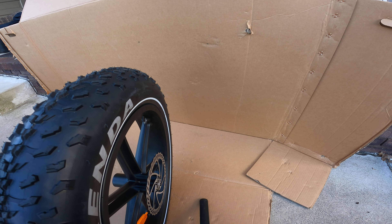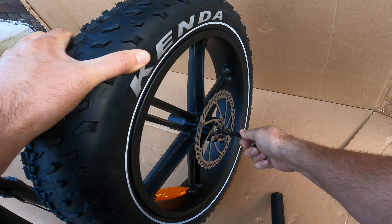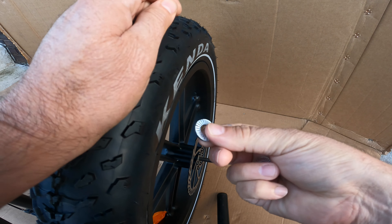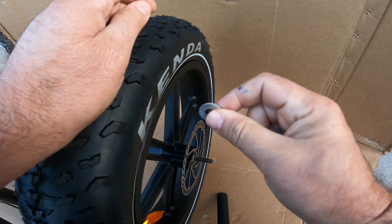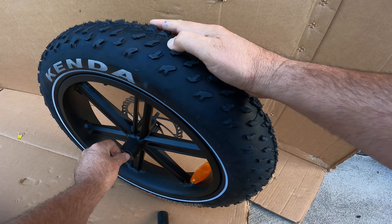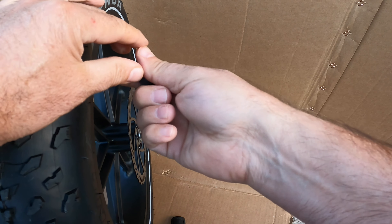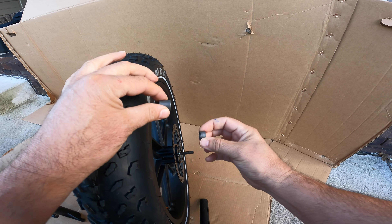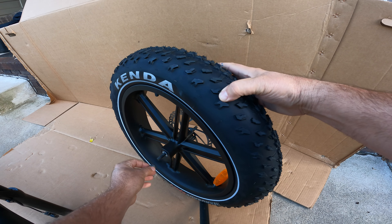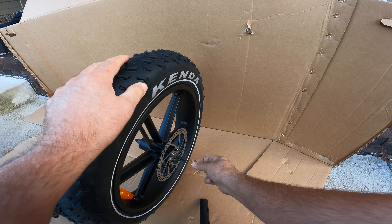So what we're going to do is pre-assemble the front tire. We're going to take our axle and stick it directly into the center of the tire. Each side of the tire is going to get a washer, and both sides are the same. So put a washer on both sides of our tire. Then we have two spacers and they're different widths — I'm going to take the narrower spacer and put it on the side with the rotor, and the wider spacer on the opposite side. Then I'll put the additional washer and the nut on the outside.